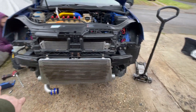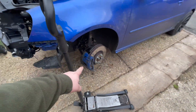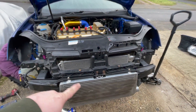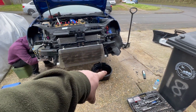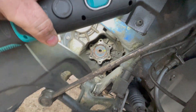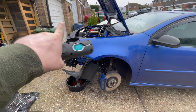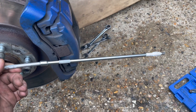I've got the front end off now - just the bumper, the intercooler pipes and the bolts. You just need to drop the four bolts here and the other side to get the front end off, then drain the coolant. Harry's gone ahead and done the bolts for the ball joints on both sides and he's just tackling the drive shafts on the other side now. The drive shafts are now off and then we can do the dog bone mount, then start stripping the stuff off the top of the engine and gearbox. Definitely making progress.